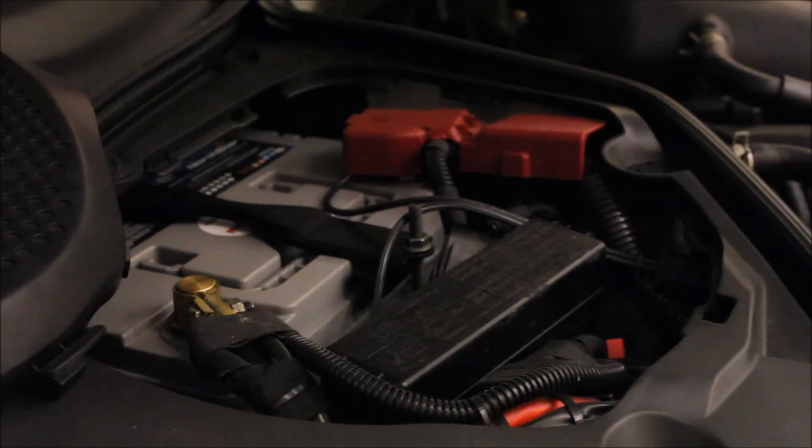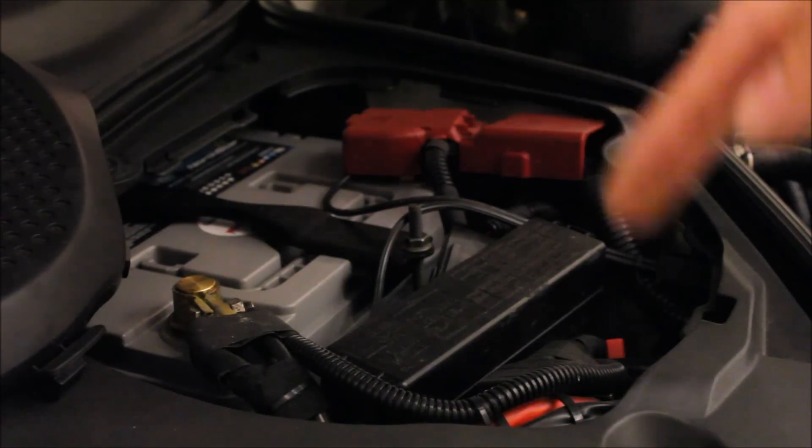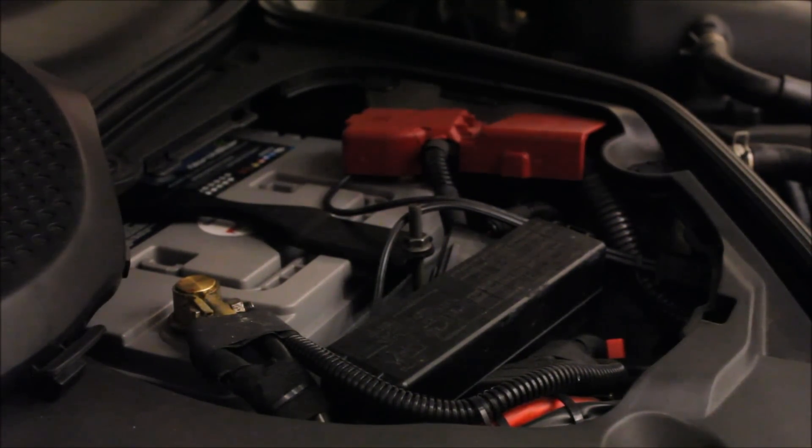Since these things are on the kick or in the engine bay and they're not directly connected to each other by a wire, that means if the ground is poor or the metal in between is poor, we might have a bad ground. That's why we upgrade — we start making connections on the firewall, the engine bay, and into the kick to help make sure everything is connected well together. I went overboard on mine. I actually run the ground from the negative terminal inside, bolted to the kick, making junction points, doing a perimeter around the whole car. The theory is to have as little resistance as possible for all the devices.